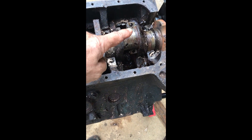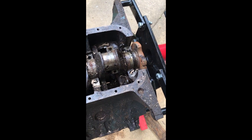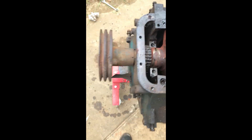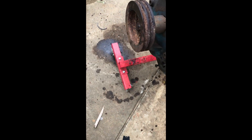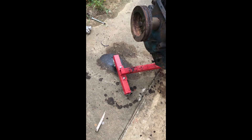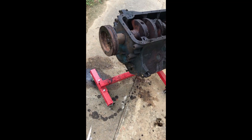All this stuff you see in here is a piece of oak I used to try to drive some of the pistons out. With great luck, there's the number seven piston — I didn't think I was going to get a piston out today. Getting to this point, I'm way ahead of where I wanted to be. I'm going to clean that piston up and work on this oil pump. The problem is this little bugger here — he's not moving. I'm going to get a bigger air wrench, and also a torch to heat up around it so it expands and breaks free.